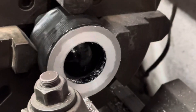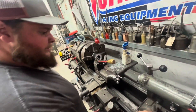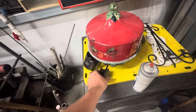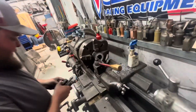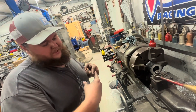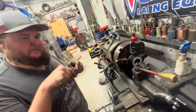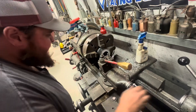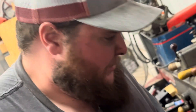We've got our 50 thou cut off the top of that piston — she's looking mighty fine. Now we're going to take the boring bar and cut 180 thousandths off of this lip, which doesn't make it perfect with the wall on the inside of the bowl, but it's just right there. We've still got a tiny bit of radius before it goes straight wall, but we are taking a significant amount out of the lip — getting rid of the lip about 99.9999%.